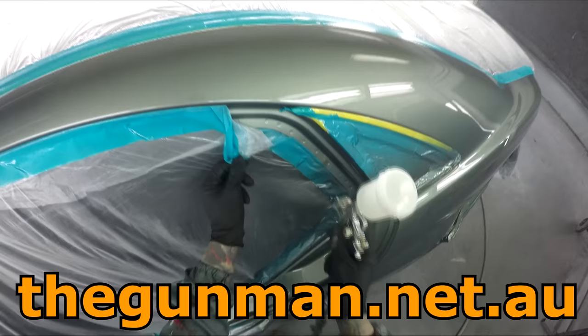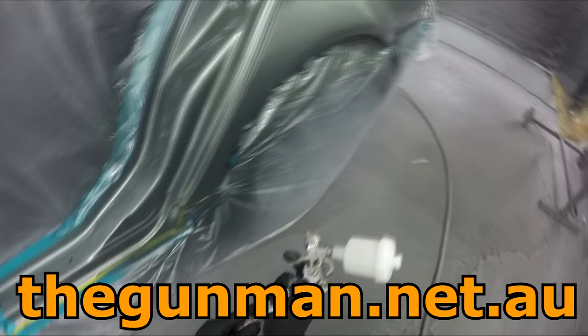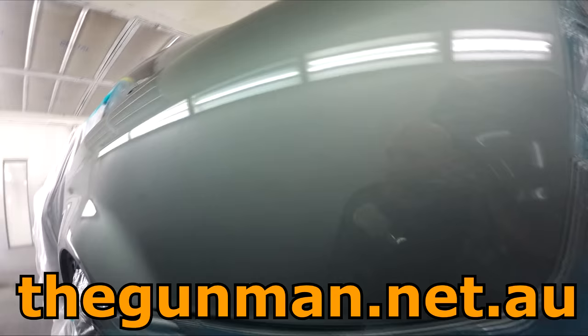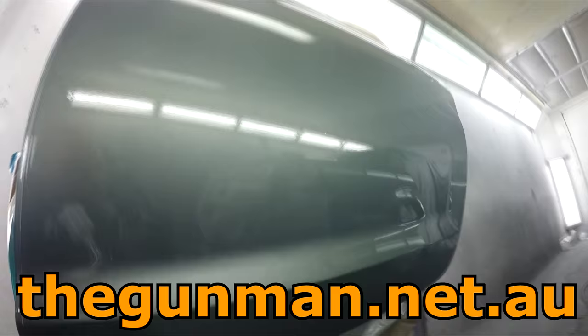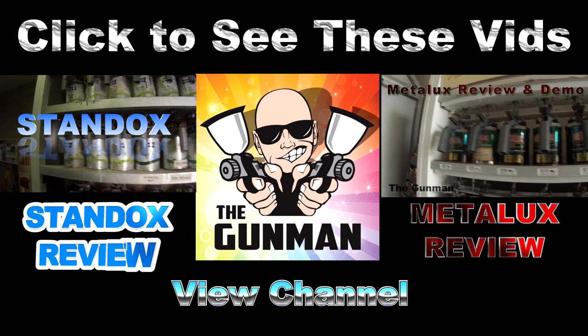To finish off I'm doing my little fade-outs where the clear ends — that's AK 350, the Chromax AK350 fade-out thinner. I'll leave that in the gun. If you're doing it on an exterior panel, I like to mix it with my clear coat — I tip most of the clear out of the gun and put the fade-out thinner in so it gives it a bit of body. For the insides, that's all you need. It'll get a light hand polish and job done. That's all I could get for this video — stay tuned for the next one. Now you've seen this video, get out there and paint some shit. Thanks for watching.